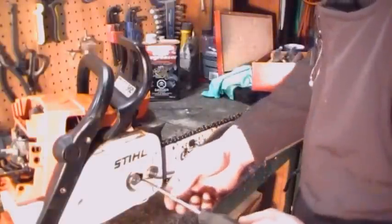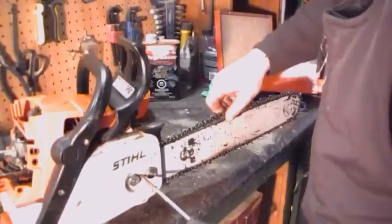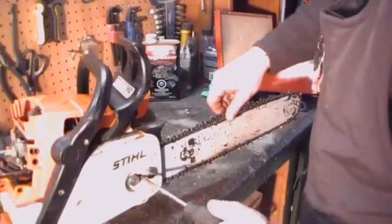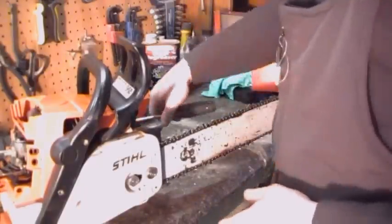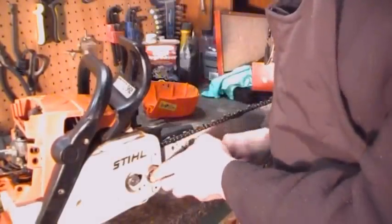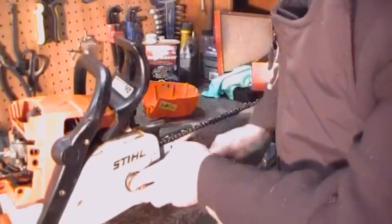Take your flat top screwdriver. I like to hold up on it. You tension it. See, it's going tighter. And that's good there. Like I say, usually any tighter than that, and you'll find it binding all the time. Alright, we'll take a 3/4 wrench, finish tightening these nuts. And we'll get back to putting the rest of the saw back together.